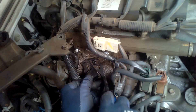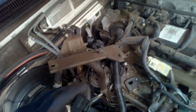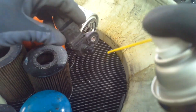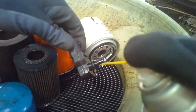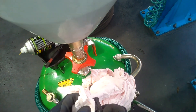Once you have access to the sensor itself — in this case it was a bit jammed — I get the pry tool to force it up out of position. They can jam in there when the seal is nice and tight. This one has a decent amount of carbon build up on the top of it. For quick testing purposes I cleaned it up, making sure I got everything off so it could read as good as possible, to see if there was any change after cleaning and reinstall — to see if we could get any voltage to actually read and get rid of the stuck high side. But the cleaning process didn't change anything at all. I put it all back together, did a quick check, and it was still stuck at that 5-plus volt range.